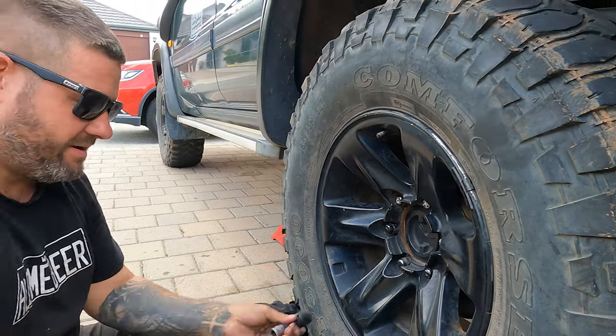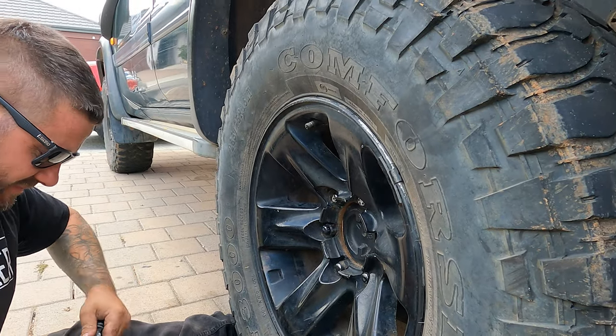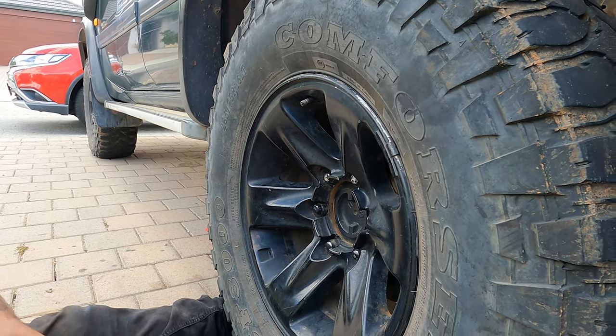Now, wheel nuts have torque settings. I will be cranking those up. These patrol wheels are pretty renowned for coming loose. Yeah, we'll tighten them up to about four ugga duggers. Don't trust the old Milwaukee rattle guns, even though they're good. Put a socket on them, an extension. In my case, I'm gonna torque them to 120 newton meters, what the Nissan factory recommend. And they know more than me.